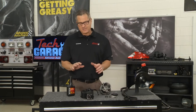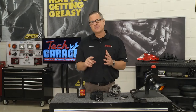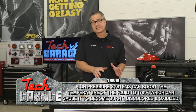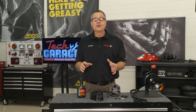Another important piece of the puzzle is the fluid — the power steering fluid. That's the lifeblood of the system: it cleans, lubricates, and seals. You remember when we used to put transmission fluid in it? Well, you don't want to do that anymore because these pumps have evolved and become pretty technologically sophisticated, and so has the fluid. Make sure you follow your manufacturer's specification for the fluid for the vehicle you're working on. We'll head over to the truck and do some diagnostics on the pump, right after break.